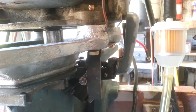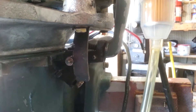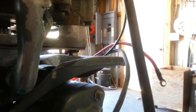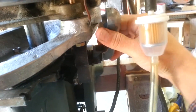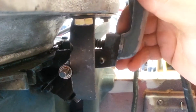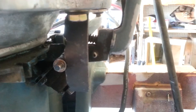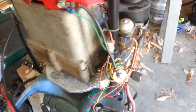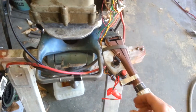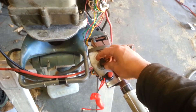I'd also like to show the detent a little more so you can see — it's a piece of steel that's just bent, goes up under the motor mount right there, and it seems to work pretty good. Now I have the wiring tidied up a bit. We have a lanyard kill switch for a wrist strap and a key switch for the electric starter.